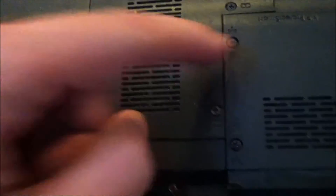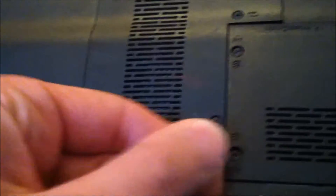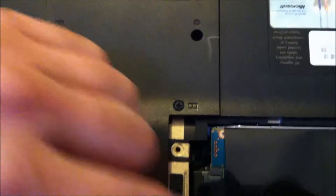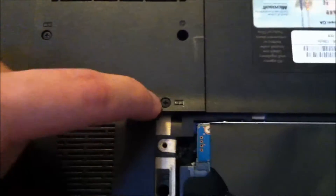So we're going to take this screw, this one, and that one off. You're going to loosen this screw and that screw until it pops up. Same way with these screws here, and this will come out completely. That's for your CD-ROM drive. I also have one more screw here.